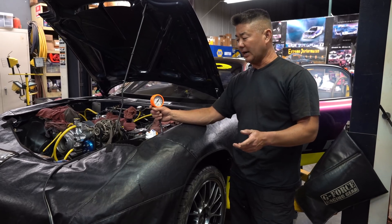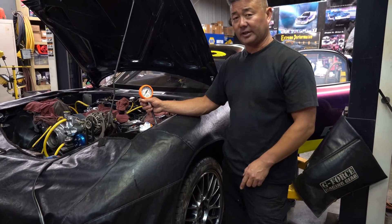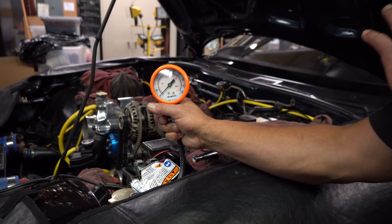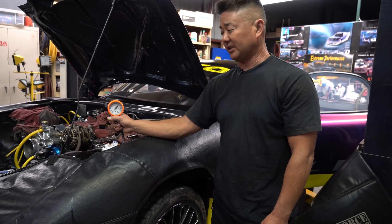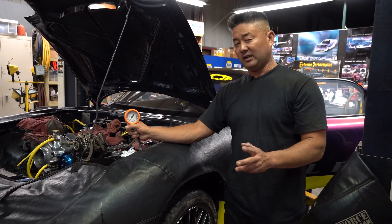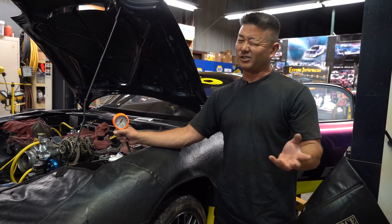With the compression tester hooked up to the front housing, we're ready to give it a whirl. Of course, we want to confirm we've got 100% on the battery — I let it sit there a while to make sure it's topped off. We'll do the same thing: run it and see what it does on the gauge. Remember, what we're looking for is even pulses. I've got quite a bit of experience watching these things. What I saw was one of those pulses is weak — I've got two that look like good pulses running close to 75 pounds, but I'm pretty sure one of the pulses was near 60 pounds, plus or minus. I'll run that back in slow-mo so you guys can take a good look at it.